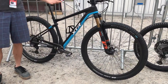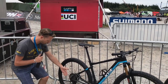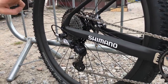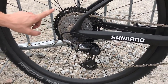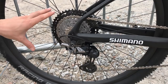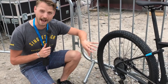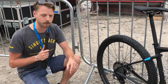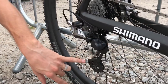So the big news, in case you've been living under a rock the past week, is that Shimano has gone 12-speed with new XTR. We have a 12-speed cassette here — this is the smaller cassette option. There are going to be three cassette options total. This is the 10-to-45 tooth option: 12-speed, 10 tooth on the smallest, 45 on the biggest. A nice tight cluster, probably more suitable for racers — Enduro or Cross Country — who might not need as big a range but want smooth gear changes and less interruption to their cadence. You can see we've got the new 12-speed rear derailleur on here as well.